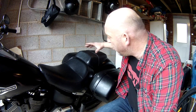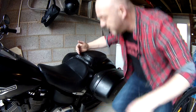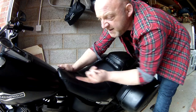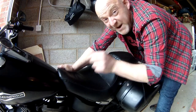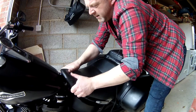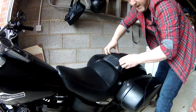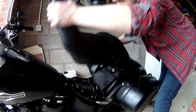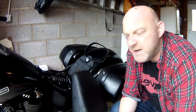Right, let's do the other bit. Okay, so now what you need to do is get this strap and push it all the way forward to this crease mark here — that's the only way it's going to really work. It doesn't look pretty but that's the only way you're going to do it. The next thing is to push the seat back as far as you can. What you have at the front here is a tongue that actually fits underneath the tank, so you need to wiggle it away so it clears that — but be really careful not to break it. Pull back and then move it slightly to the side and then it will come away. Just rest it there gently. Pull the strap back here like so and then slide it forward and out.